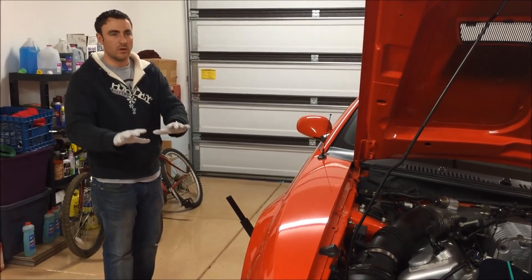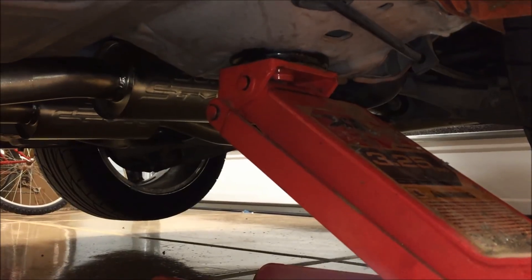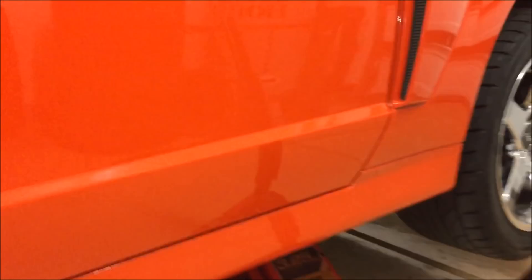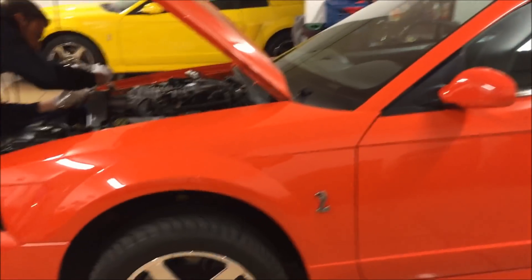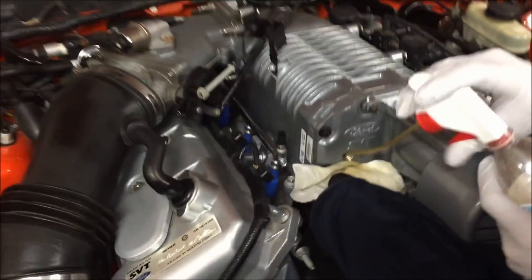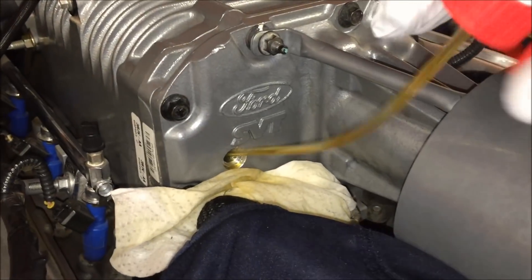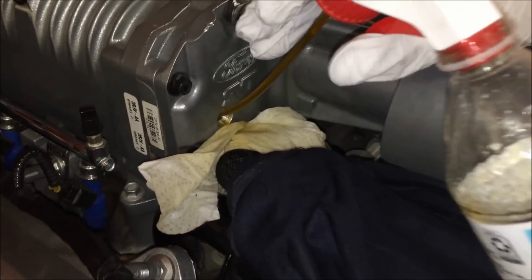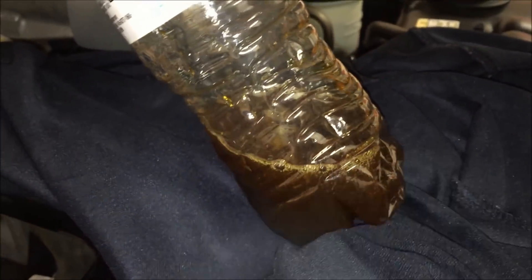Now lower the car back down to get the oil forward, then lift on the back of the car to push the oil forward. We then lifted the car on the rear torque box — with a jack stand underneath for safety. By lifting on the back driver's side it tilts the supercharger forward and downward, getting everything out that we can. Keep repositioning the straw until you strike oil — you should be extracting about eight ounces.